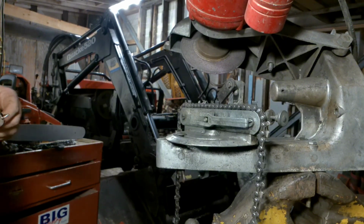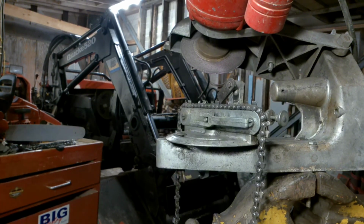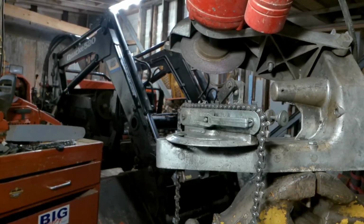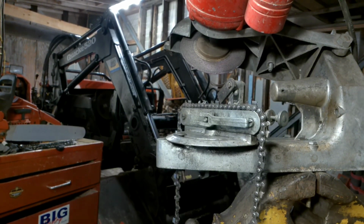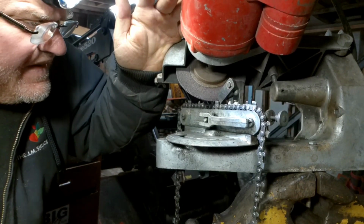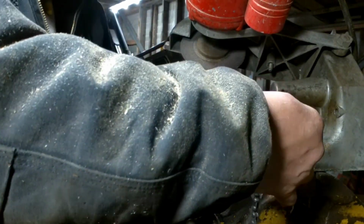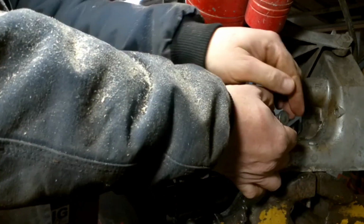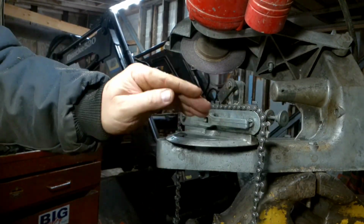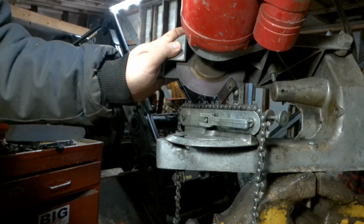Let me get my up close glasses. Oh, yeah, they're hanging on my shirt. Make sure that looks right. I'm going to guesstimate. Okay. I think that looks good. Oops. No, you don't. That locking screw's tight. There we go. I won't lock that down yet, that adjustment for forward and back, until I knock this in first, nor will I set that depth adjustment until I see how deep I need to go, because I'm hitting on top of where I'm going to, the meat right here where I'm going to cut off.